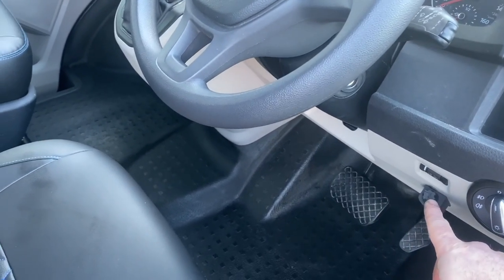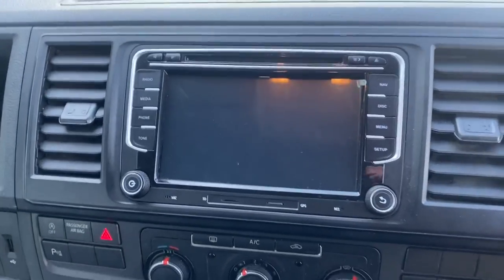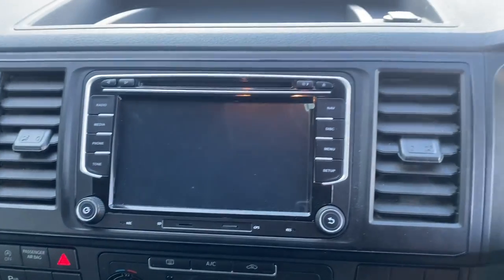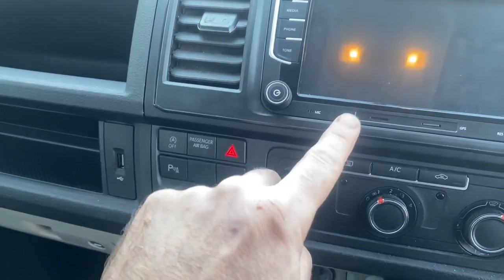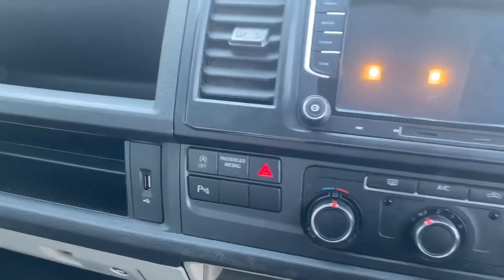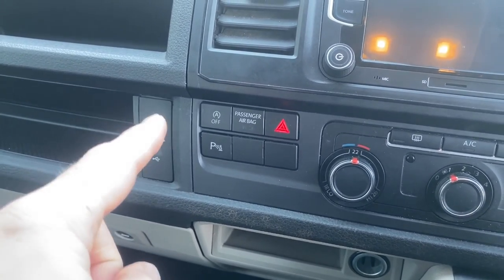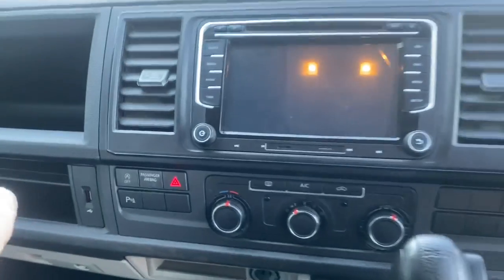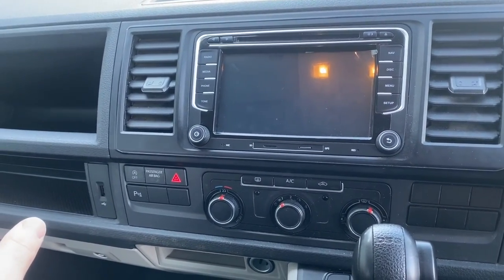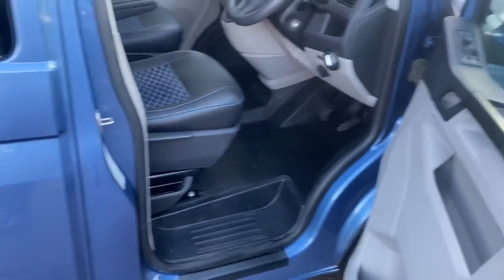Around the driver's side, we've put the sub control here so you can increase the bass. This is the upgraded head unit we've installed — it looks very Volkswagen-like. The USB on the original Volkswagen radio was a different size, so we 3D printed a cage to clip the USB into so it lines up correctly. That makes the aftermarket radio look completely factory and genuinely Volkswagen. You do get a lot of audio out of the van although it looks completely original.